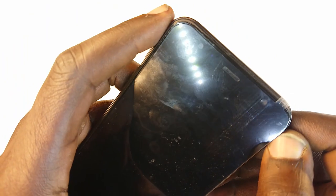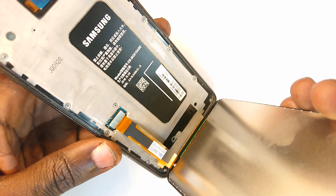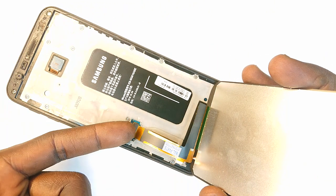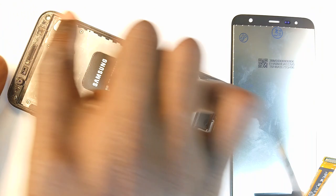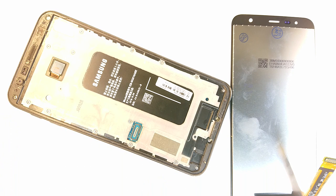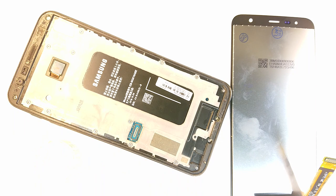Hit the subscribe button and always return. This phone is actually not glued in yet, and that's what we are going to do just right now. Right now it is plugged in, so first course of action is to remove this, clean the peripheries, and then apply adhesive on both surfaces, bring them together, and bond them. We'll bring our adhesive — it's usually isopropyl alcohol that we use to help in our cleaning, because it is volatile and capable of dissolving organic dirt. So we get our little bit of tissue, or in this case a piece of fabric.